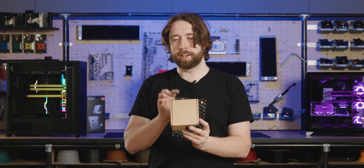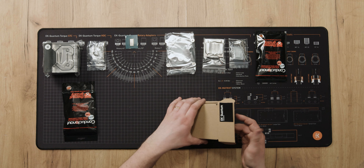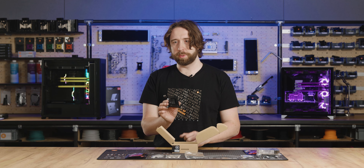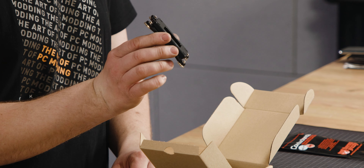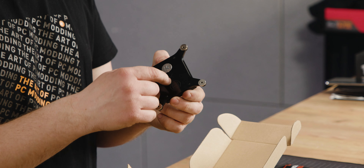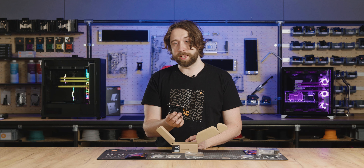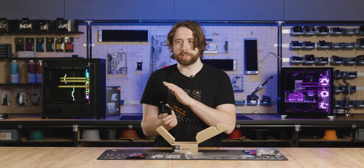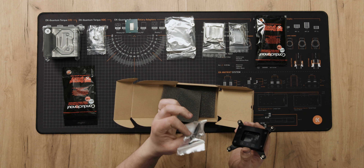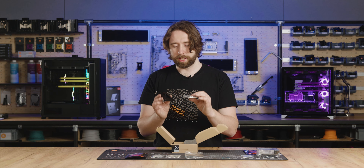The last product we're going to look at is the ILM replacement kit. For those of you who don't want to go through the risky process of delidding, you can also get a performance benefit by using this part, which is a replacement frame for the loading mechanism that comes on the motherboard. It comes with the same really extra thick rigid back plate that you would have on the direct die kits, and this really reinforces the motherboard from the front and the back. It prevents the socket from distorting, and most importantly, it keeps the IHS as flat as possible, so you get the best contact from ordinary thermal paste. What's supplied is Thermal Grizzly Hydronaut, along with the allen keys to install everything.